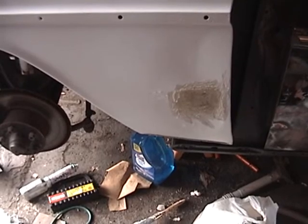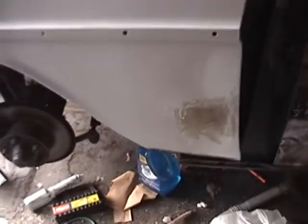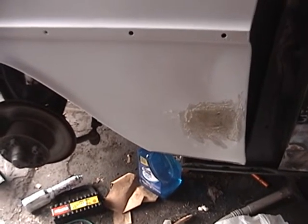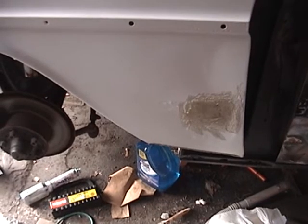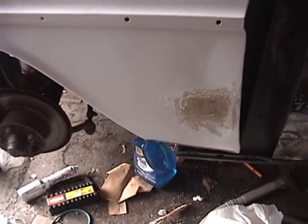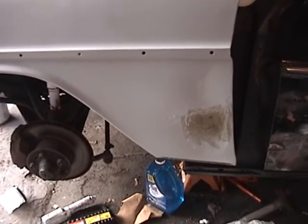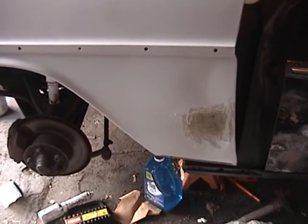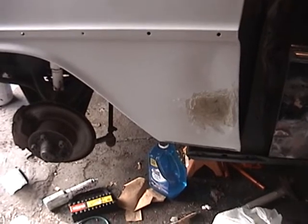What I can do right then is sand it down a bit. It doesn't actually have to be very exact because I'm going to be bondoing over this. I can also seal off the back of that to prevent moisture coming through and spoiling any of the Bondo work on this side. Tomorrow I'm going to be working on smoothing this out even more. I'm probably going to spray the back of the fender with a couple of layers of truck bed coating, really just to seal in the repairs that I've done so far.